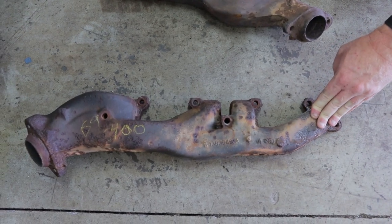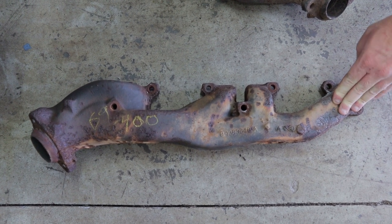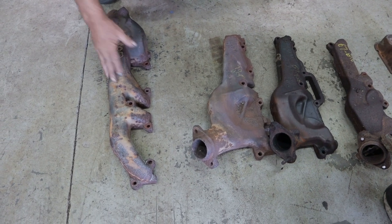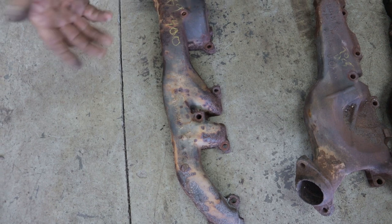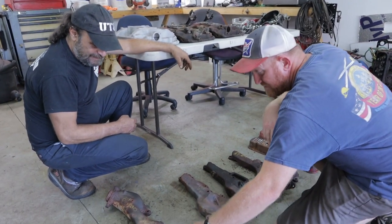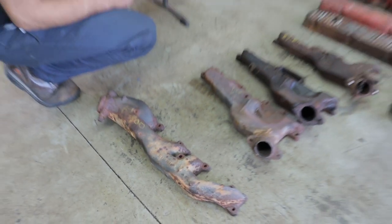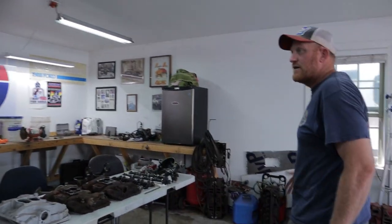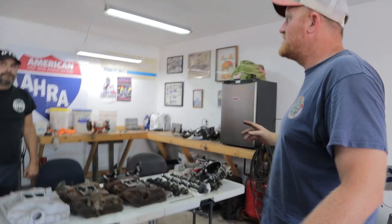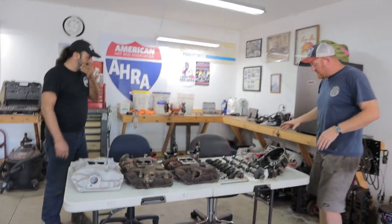The passenger side exhaust manifold is pretty much the same from '67 all the way through '76. They put some thought into these manifolds — they're definitely not a typical log style. The curves actually promote scavenging instead of just being a lump, so they flow pretty decent. But headers are a big deal for big block Buick because the exhaust runner on the exhaust side is angled downward, which totally inhibits flow — you'd want it to go up out of the exhaust port, like small block Mopars do.